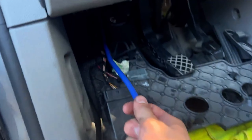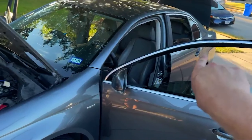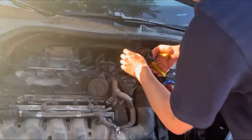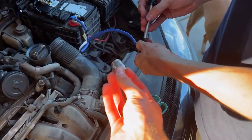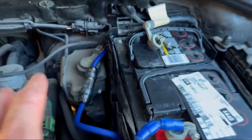Once you painstakingly fit your power cable through the firewall — if you own a Volkswagen Jetta — now the challenge is going to be trying to hide the wire going into the trunk. We got one power cable going to the trunk, which we need to put a fuse on. Because if we don't and it blows, it could mess up the wire and then we blow up, so put a fuse. Even our master electricians mess up. But we got the fuse put on. Now we're going to hook up everything and then bring the sub to the trunk.